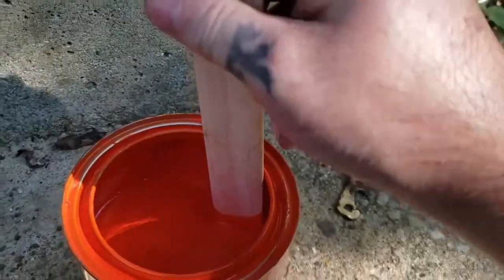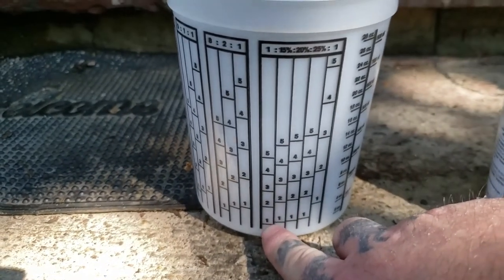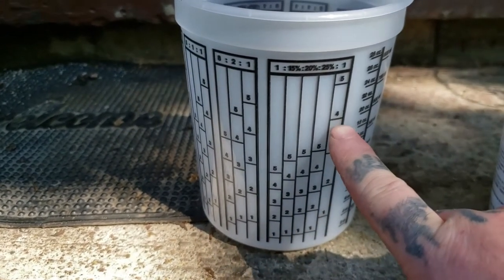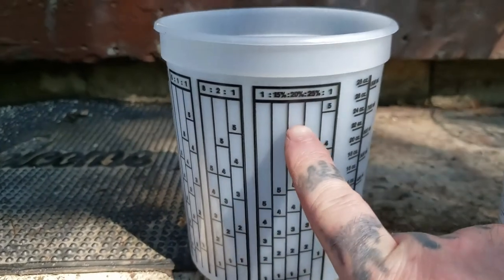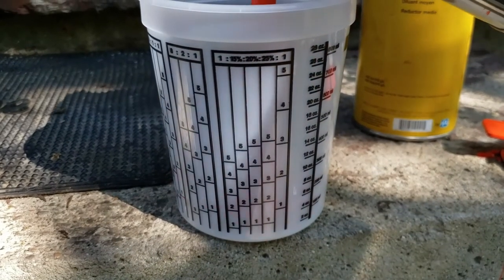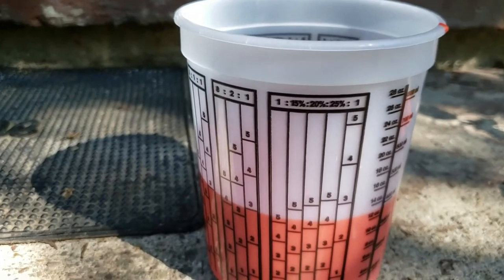Let's open this up and I'll show you the color as we're mixing it. About a quarter of a quart used — that's been one engine's valve cover, engine block, and oil pan. So a pint if you're just doing one engine will be plenty; once you mix it you'll have half a quart. Pretty color — you don't get that in a spray can. This mixes one to one, so on your mixing cup find the one-to-one section. If you fill up to the one here on the four, you fill up to the four on the one side. Filling up to the four adds 15 percent — that's if you want to add reducer. I'm going to fill all the way to the five because we're painting two motors.